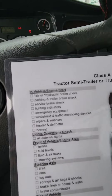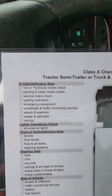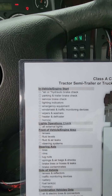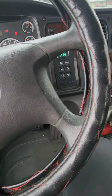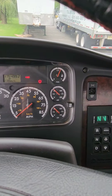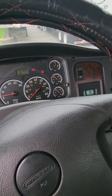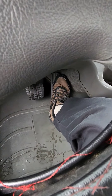Right now we're doing the air brake check — we have air brakes, not hydraulic. I'm going to do the entire in-cab check. Make sure you're checking things off as you go. We're still waiting — air pressure is at about 50 PSI. Remember this may take longer than usual because we started at zero. On the test it just has to be below 90 to start. I'm going to help it along a little to speed this up.